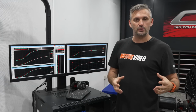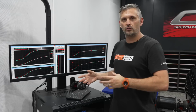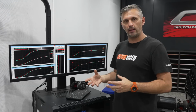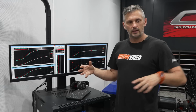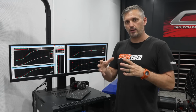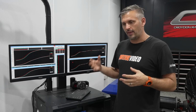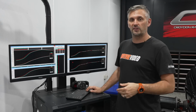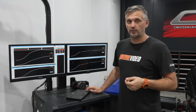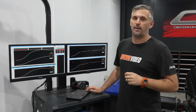If you have a medium frame turbo, the collector that you use will be different to whether you have a large frame turbo or low mounts, etc. So it's about picking the right inlet, the right turbo, and the right capacity to work together. That's the thing out there. Some people want their car to look awesome, and they're not as concerned about this sort of stuff, while other people purely just care about performance.